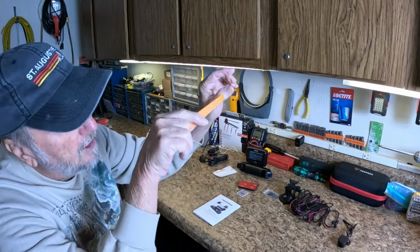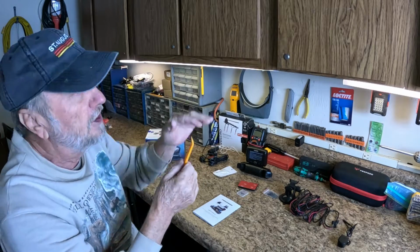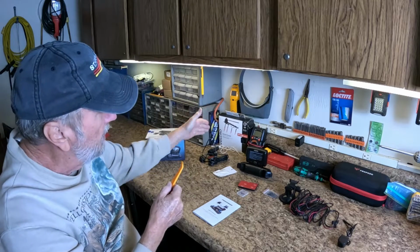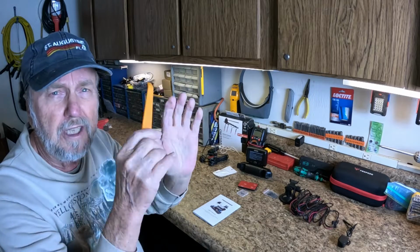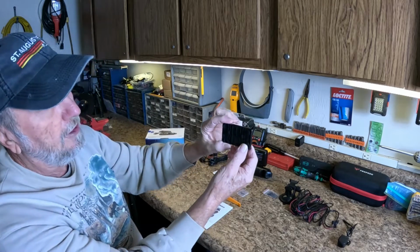It's very sharp, and you can just pry that back and stick that wire down in if you want a nice, neat finish. Like from when it's mounted on the windshield, run it over the visor, and then down the door frame, and then you can take it under the dash. This will be very helpful for getting it underneath that weather stripping. You also get a mount for the windshield.